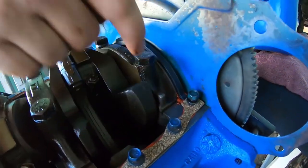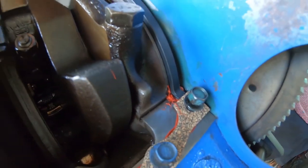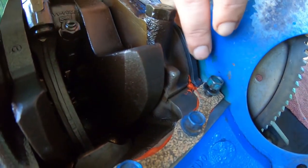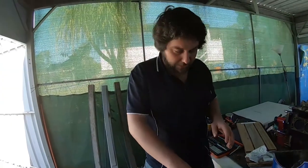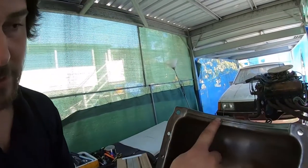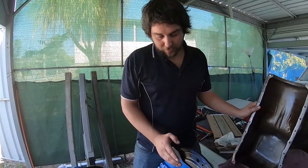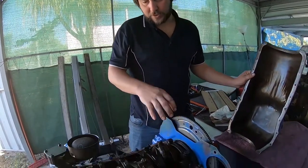See how the cork has tucked in perfectly — if you do it the wrong way, I have seen it, they put the cork on top and it doesn't seal, there's a gap under there. Some guys like to put a big bead of silicone under there; I'm not going to, because it's got those two lips that will squash and seal really good. The reason I put a slight bead on here is because that little bead is meant to squash into here to make a turn channel. If it's dry it can push the gasket out of the way, but if you put a little bit of silicone it's wet on the surface and it'll just help it go on.